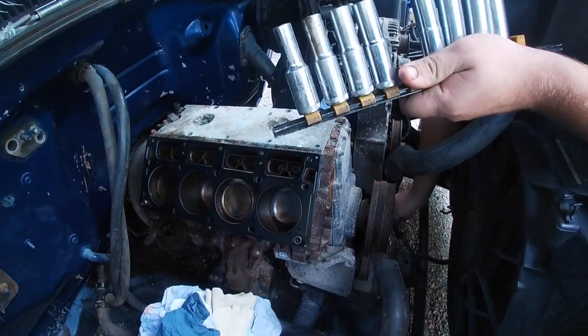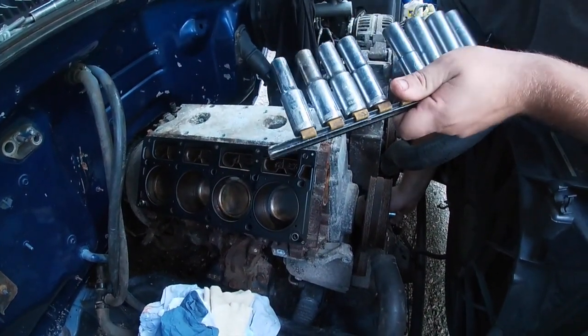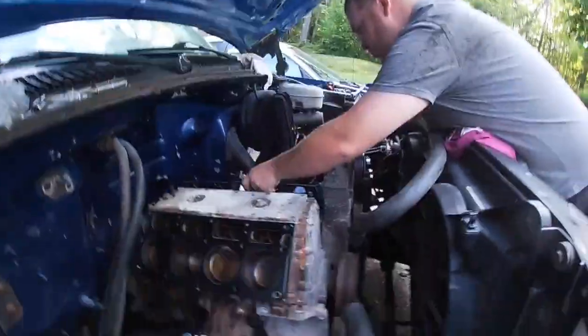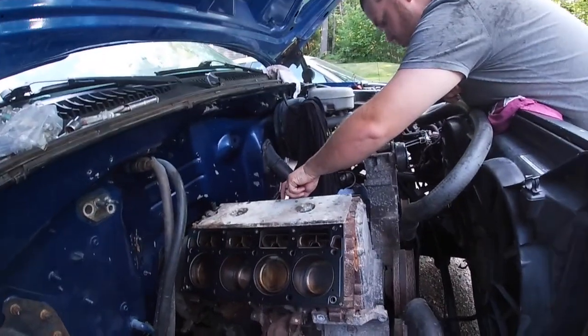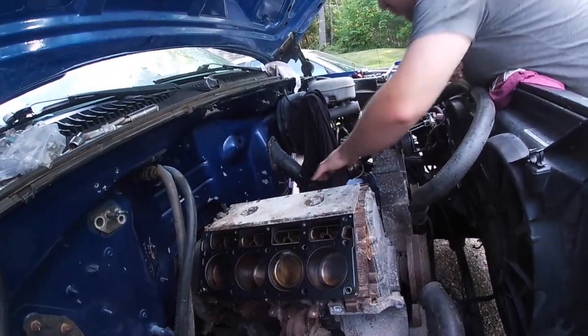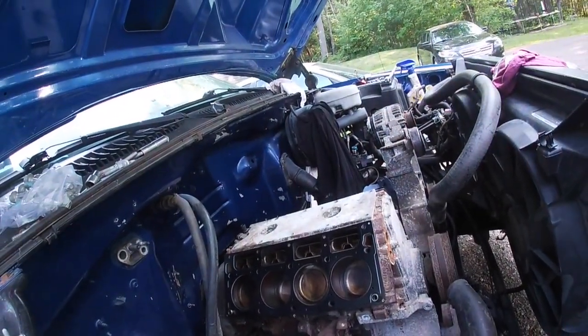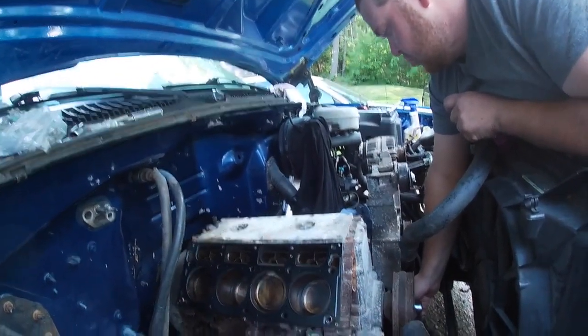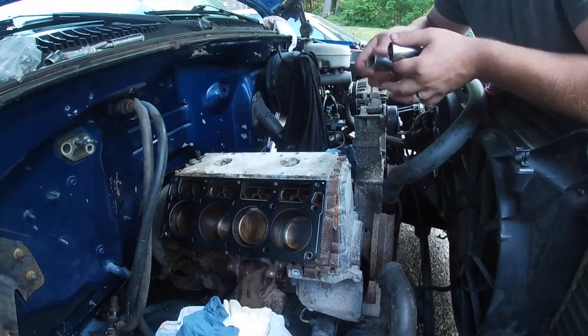So you can get on the crank now. What size is it? That's 21. That's still not big enough. So you want a 22, 24? Yeah. Because since we got the gasket, we might as well, because you know this is going to see boost. Those gaskets don't look that good. What do you mean? How it's up like that, just not pressed together.